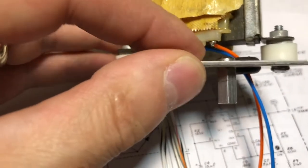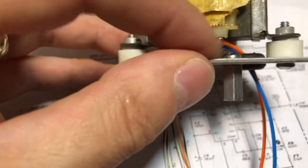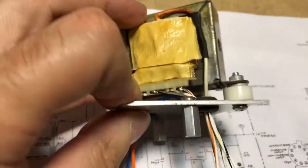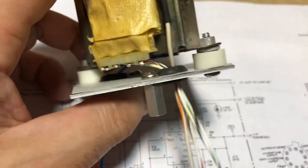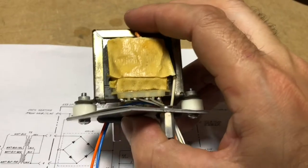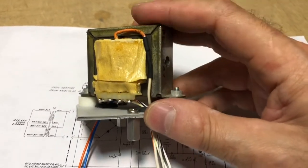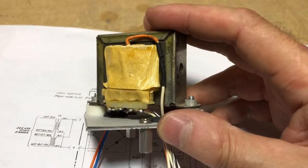There's still a pretty good amount of gap — probably a quarter to three-eighths of an inch of space between the terminals of the transformer and the mounting base — which should be plenty sufficient. With this metal and the standoffs, it's a very rigid mounting system with no flex. We'll mount it into the frequency counter and then look at some of the wiring options to get this wired into the unit.